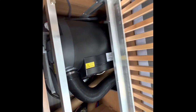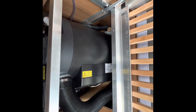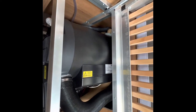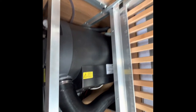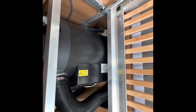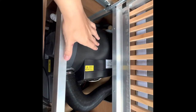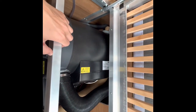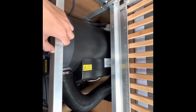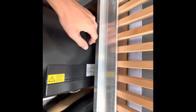When you come to reuse it, shut the yellow toggle down, shut the fresh and waste outside, shut all the taps inside the motorhome, and go and fill the vehicle with cold water outside via a hose pipe. Come in, put your control panel on, put your pump on. Go to the cold side of the tap first to get a pressurised flow of cold water straight away. As soon as you start going to the hot side, you'll get coughing and spluttering through the tap because it's transferring water from the fresh water tank into the boiler, filling it with 10 litres. Until you get a free flow from the hot side, that's when you know the system is primed. Make sure you drain your boiler off in the winter — otherwise it's a costly mistake and it's not covered under any warranty, as it's your responsibility.